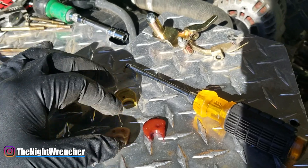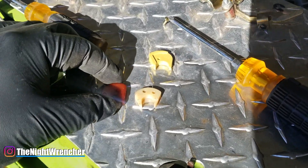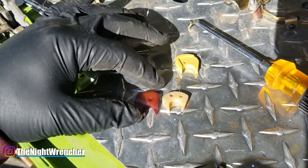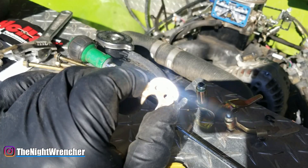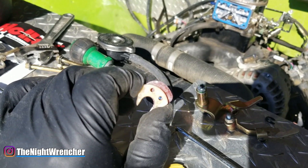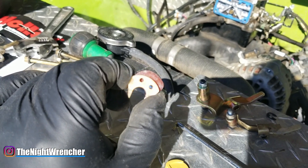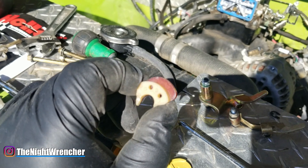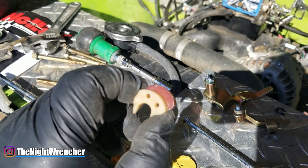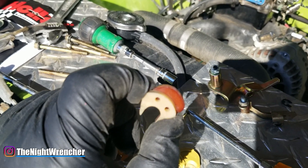Another thing I want to show you is the relation between the two different cam profiles — in reality this kit comes with three, but I haven't been able to figure out all the differences. The white cam on the right is the one that was already on the carburetor, and the brown cam on the left is the one replacing it. As you can see, the 50cc cam is considerably more aggressive in order to take advantage of the full 50cc's, and it also has a more aggressive ramp. You only get one chance to install it correctly — if you don't install the correct cam, your 50cc accelerator pump is not going to work. Don't try to install a 30cc cam on a 50cc pump because it won't give you the results you want.